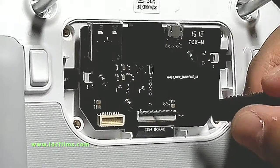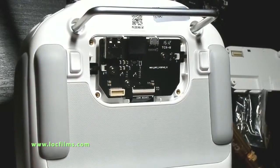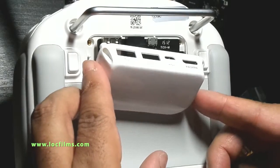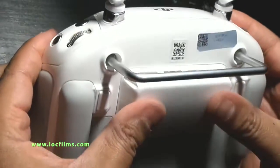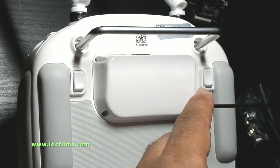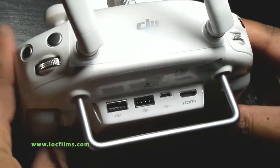These are just little locks, and then the main one right here is a little bit tougher to do, but you can use your hand on this one. There we go. And now the HDMI cover board goes on. We just replace these screws, and that's it — now you have HDMI.